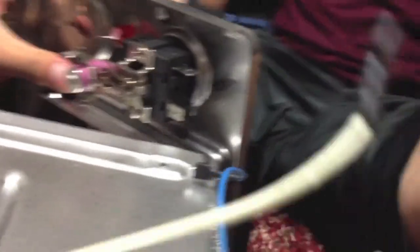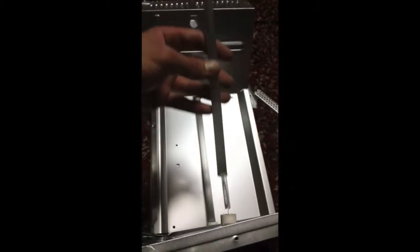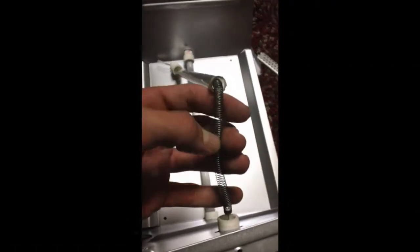The main objective of this toaster oven is to heat and prepare food such as bagel bites, frozen pizza, hot pockets, and of course toast. It produces heat through electrical current — a flow of electrons through a conductor. In an ideal conductor the electrons move freely without losing energy, but this is not what you want for heating. This is where resistors come into play: a resistor impedes the flow of electrons, forcing them to collide and rub against each other, creating friction and significant energy loss as heat — exactly what allows us to use them in toaster ovens, water heaters, heating blankets, and light bulbs.